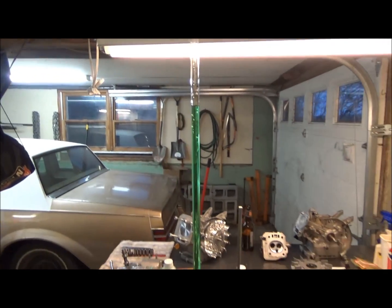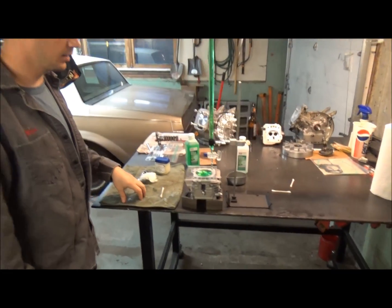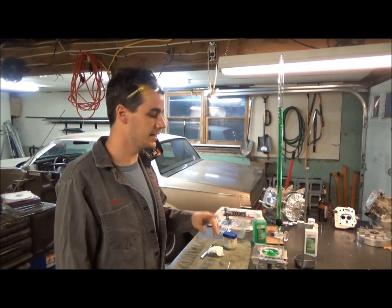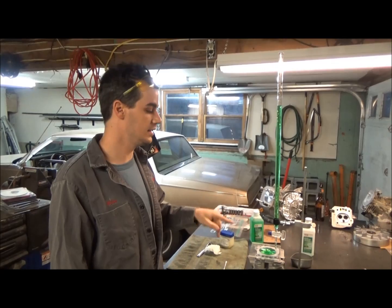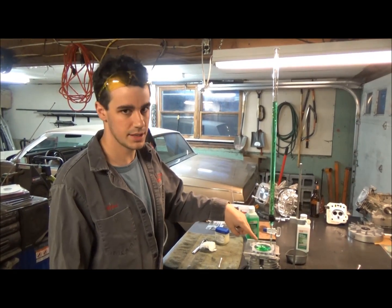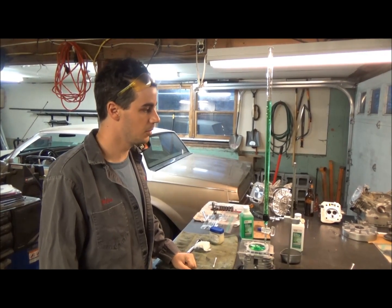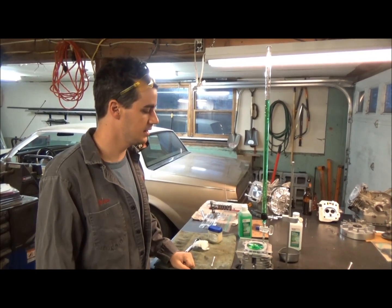That's going to be a good number for us. It actually seems slightly smaller than I measured before — I did measure this previously with stock valves and a different spark plug. I think these valves aren't dished and that plug probably takes up a little more volume, so it looks like we lost about a cc.